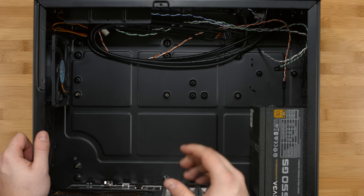We've got our wireless AC adapter here from Asus — it's a pretty cool little device. Inside we have the adapter itself in a gorgeous red, two large antennas to stick out of the back of your case, an external base for the antennas if you need to move them further from the PC, and a low-profile adapter if you want to move it to a case without full-size expansion slots. Let's install it into the motherboard — it should slot directly in — and then we'll screw it into the back of the case. Don't forget to replace the retention bracket after installing the Wi-Fi card.